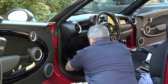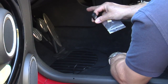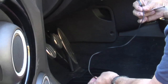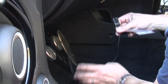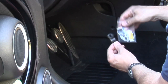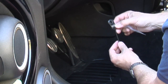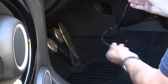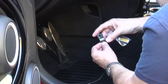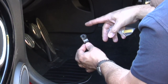The pedal has now been reinstalled and we've connected the other end of the Sprint Booster to our factory wiring harness. Now we're going to tuck this cable away and get it out of the way of our pedal so we're not going to be stomping on it. The Sprint Booster comes with a zip tie and also some double stick tape — you can mount the mode switch somewhere on your dash if you have a convenient spot. I would still be very careful in routing the mode switch cable so you're not stepping on it. If you find a mode you like and tend not to leave it, you can disconnect the mode switch from the Sprint Booster and it will stay in that mode until you plug it back in and change the setting.